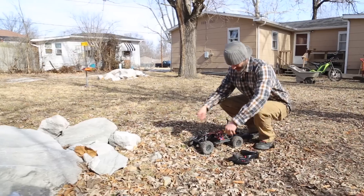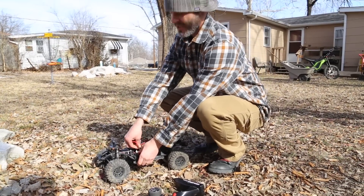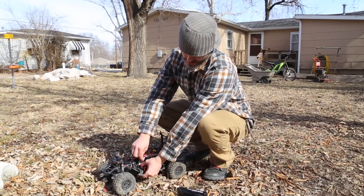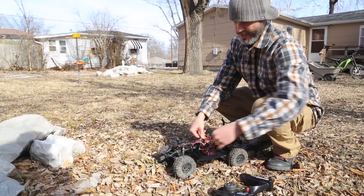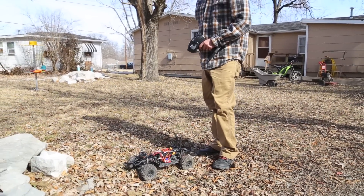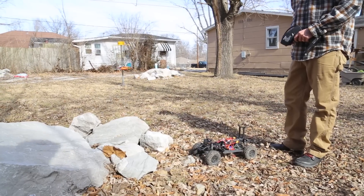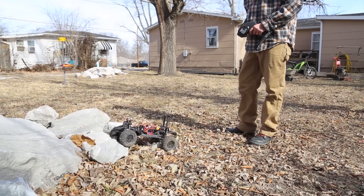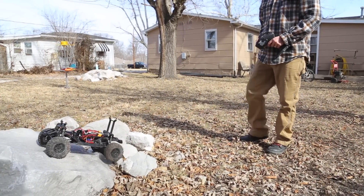So forwards makes it go backwards. In this case, all we need to do is switch two of the phase wires. You can only do this on a sensorless motor — if you do this on a sensored motor, it's probably going to smoke your ESC and/or your motor. So just remember that: only on sensorless motors can you do that. We swapped two wires. Initial impressions compared to the Mamba X ESC — we have just as good startup control, but it seems to be a little quieter. A little different noise than the Mamba X, but certainly no lack of low-speed control. We are in first gear right now.